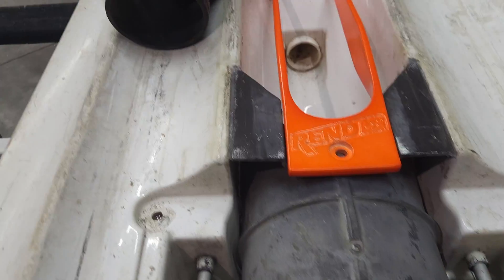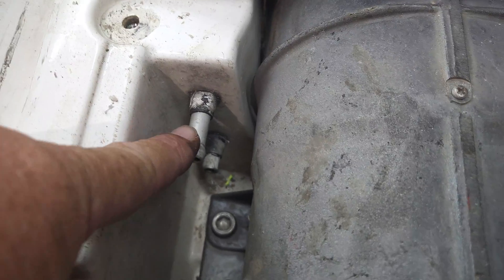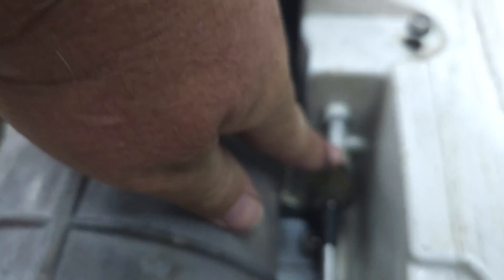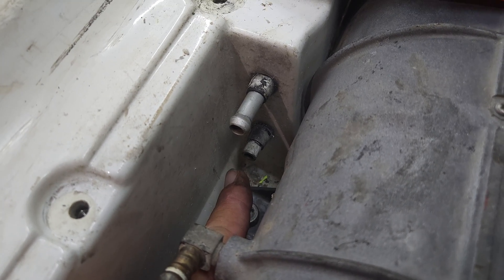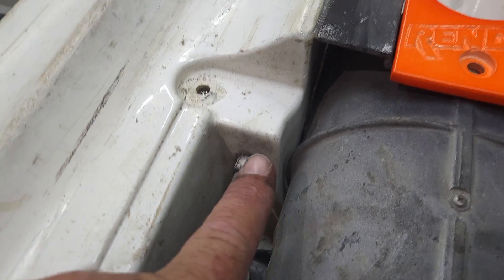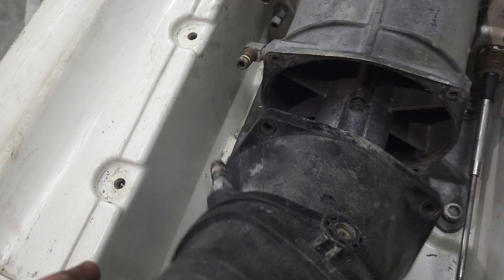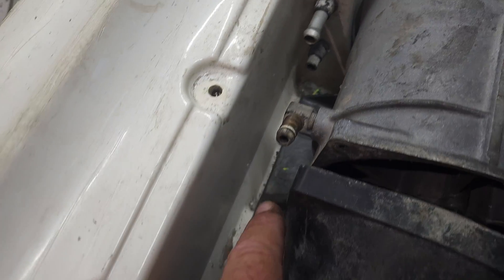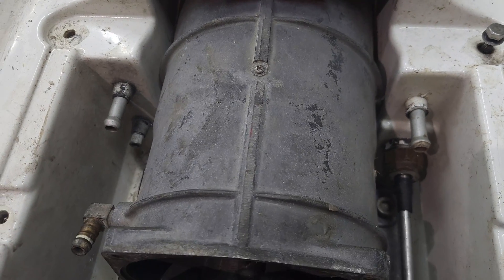As you can see, we've got the pump glued in here. We've got four bolts here, and we've got our three water tubes here. This is our cold water in — this is the pressure side of the pump here. This puts cold water into the motor for the cooling system and it goes through this tube here. Then these two tubes over here: the bottom one is a hot water dump from the engine — we're going to repurpose that. That comes out from the exhaust pipe. We're actually going to change that. And then this is the vacuum — this is the vacuum bilge pump out. This is the nozzle. Inside here there's a straw, and they use the Venturi effect here to suck the water out of the hull. So there'll be a hose here, and there's actually a bilge pump screen in there that vacuums water out of the hull.